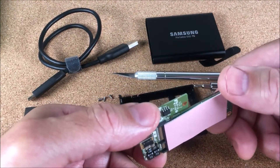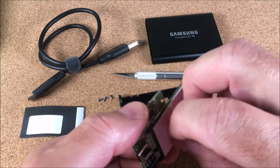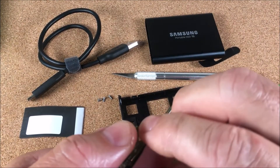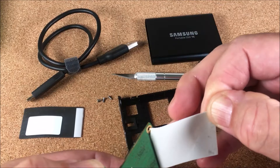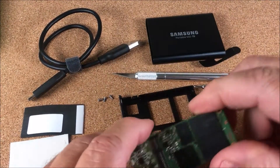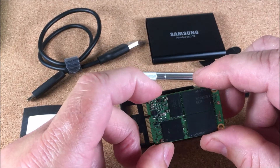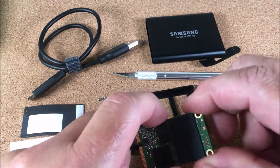We separated it from the plastic. This piece needs to be removed because if you put another mSATA there, it needs to sit on top of it to protect it. There's a piece of foam tape to isolate it from the metal enclosure — it's a good idea to put everything back exactly as it was originally. The pink one goes on the bottom side. Now it's just a matter of sliding it out — and there we go, this is the mSATA two terabyte, Samsung brand. This can be put into a Lenovo laptop.